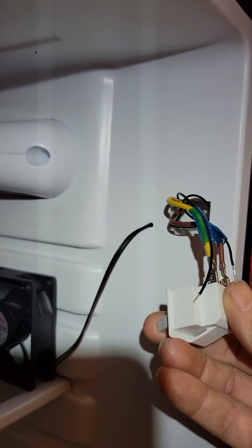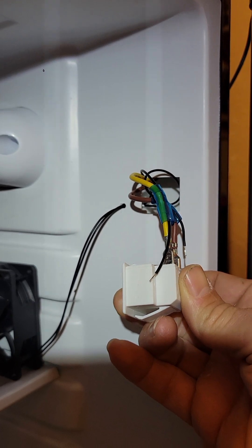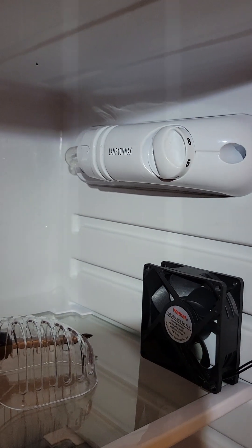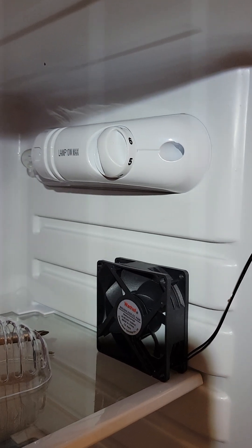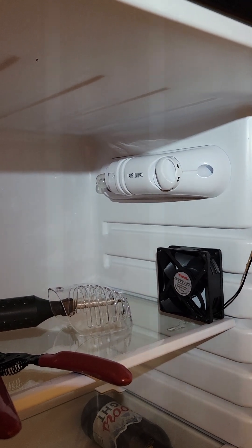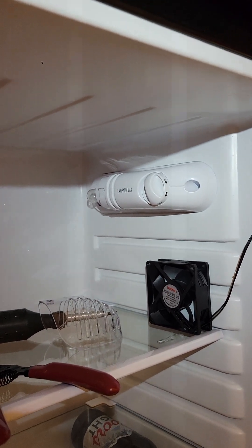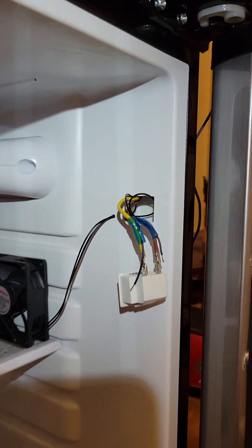My model has a 10 watt light. When the door is open, the switch opens, the light turns on, and the fan turns off. When I close the door, the fan turns on. The only problem I found is that because of the way it's wired, the light still stays on to a certain degree. I'm going to put an LED bulb in there that requires much less wattage. Display fridges have their lights on all the time anyway, and this is just for beverages, so we'll see if this works.